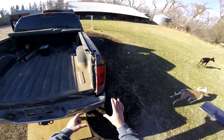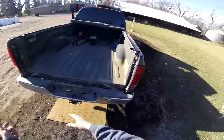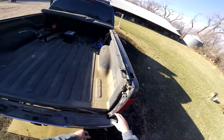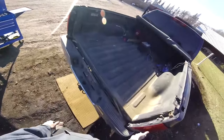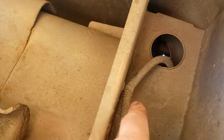But if you wanted to leave everything intact — say you're taking an old box off and putting a new box on — you're going to want to take the taillight housings off, disconnect the harness, and undo all the tie-downs holding that wire to the box. But for me, I'm just going to cut the wires and leave the taillights in because the pickup's shot. You can see where the taillight wire goes up into the box there, tied on — you'd want to take that off, but I'm just going to cut everything.